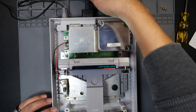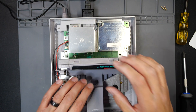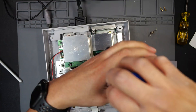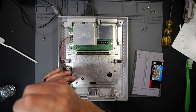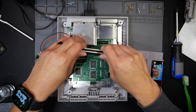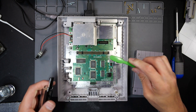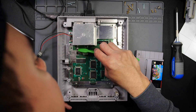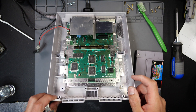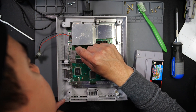We're still not getting any audio out. Okay, so I think we can actually rule out the audio board. Let's go ahead and clean the connector here. You can actually clean right underneath this — it works the same way as the N64, just pulls right up off. And it looks like there's just residue. I dare to say that this cap might actually be bad.